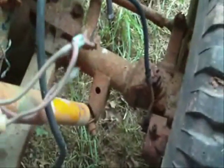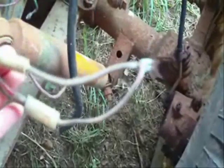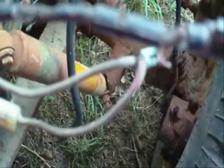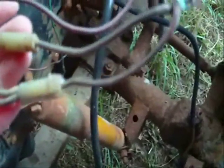As you can see, these are the fusible links that were on there. One of the problems I had when I was driving it was every now and then it would lose power, and you can kind of see why. This one's got two power wires, this one's got one, and then this one is the starter wire coming from the switch, and as you can see, it's all buggered up. So what I've got to do is change out these fusible links. Instead of going from three to two to one like they had at factory, I'm going to just put three in here — each one will have a separate link to it.